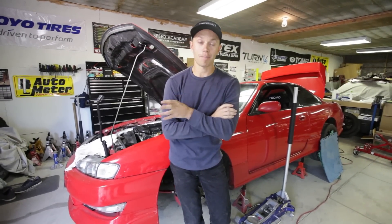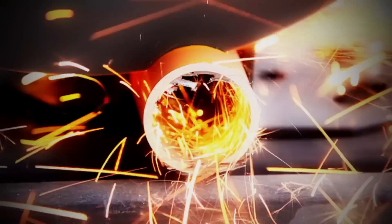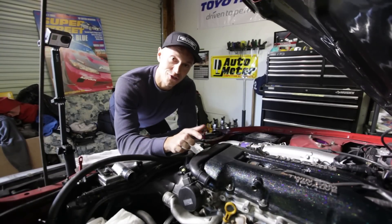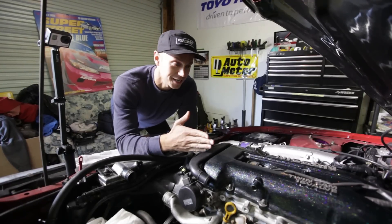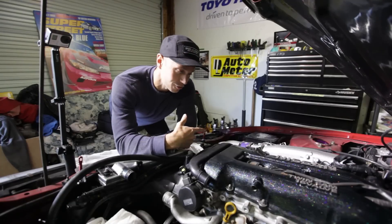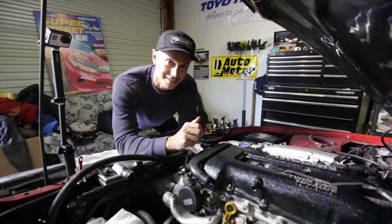In the previous video I mentioned I popped a head gasket on the SR, so in this video I show you how to take the head off and replace it. I'd love to say this is an easy job, unfortunately the turbo manifold and all the associated parts on the hot side have to come off in order to pull the cylinder head off. On the intake side you can actually leave the intake manifold, but obviously a couple of small items like the intercooler piping and the wiring have to actually be disconnected. So let's get to this, I want to get this done fast and hopefully easily.